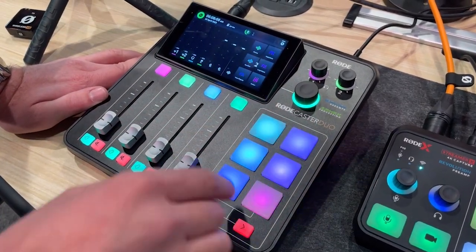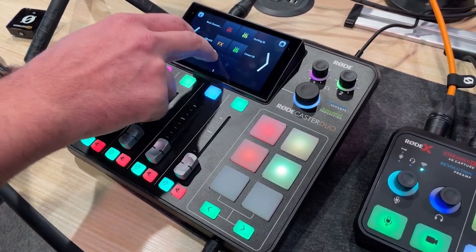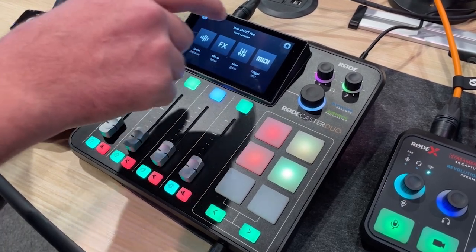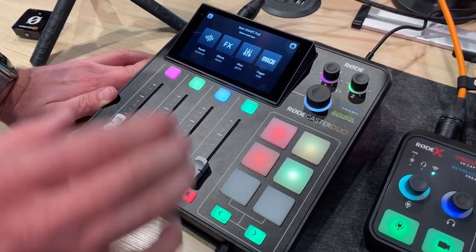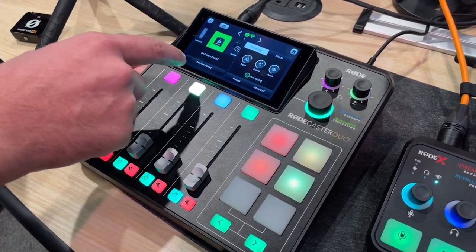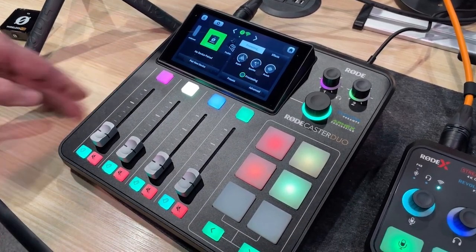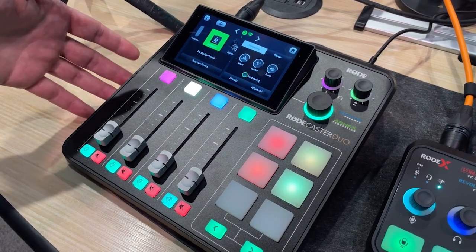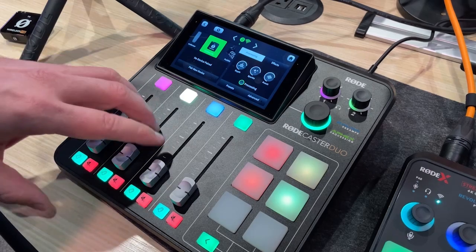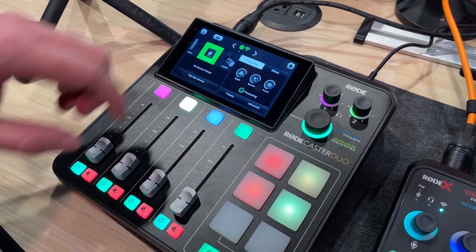You can play back sounds, run voice effects, and it has a headset input so you can plug a headset straight into the front of the unit and bring it in as a separate source. You can set up smart pads to be sounds, effects, mixer actions, or MIDI triggers. You can also pair a wireless microphone directly to the unit — it has two channels of wireless receiver built in. And that's also true for anyone who has a RODECaster Pro: you can get a firmware update to unlock the wireless receivers that have been built in from the very start. It lives within the mic locker and you just select wireless on that channel.